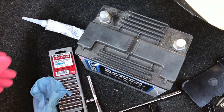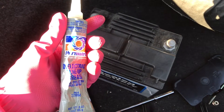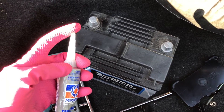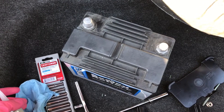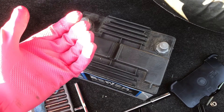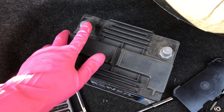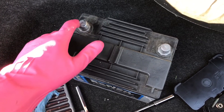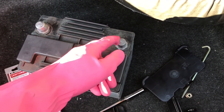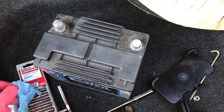I'm gonna use this old battery to demonstrate something that maybe some people take for granted and some people don't. I have some dielectric grease left over from when I had my Trans Am. One recommendation is to go ahead and put dielectric grease on the terminals. I'm using gloves because it says don't get it on your fingers. I'm just putting that grease fairly liberally, spreading it around on the terminal, covering all areas of the contacts. I've already done that on the Duracell battery — this is my old battery for the demo.